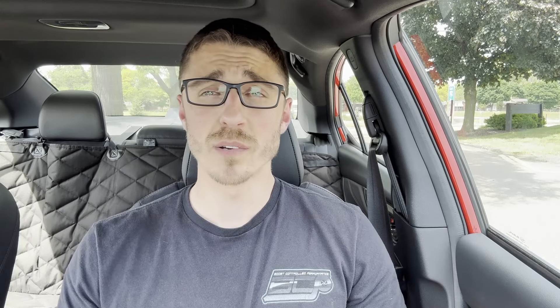Let's also talk about flat foot shift. I think launch control is more commonly understood, but flat foot shift is less so. Some people think it's bad for the car, but I'd argue it's actually a little bit safer for your driveline. Flat foot shift is activated by your clutch pedal switch when enabled in your tune. When you're at full throttle and go to shift, pressing the clutch pedal enables flat foot shift and changes the engine RPM limit to a set RPM.